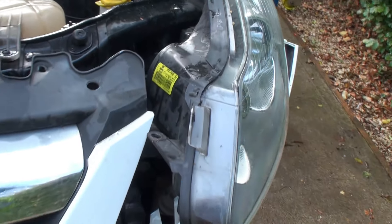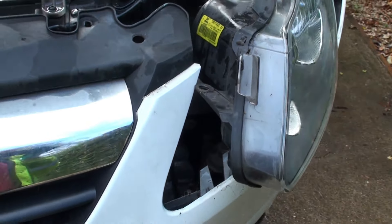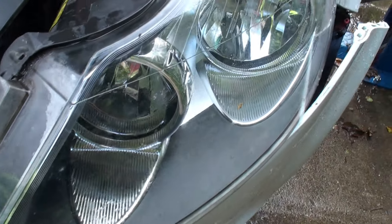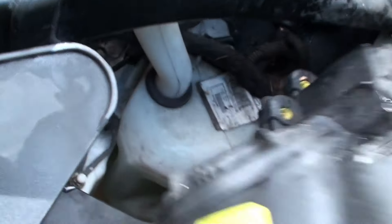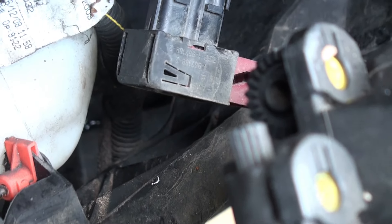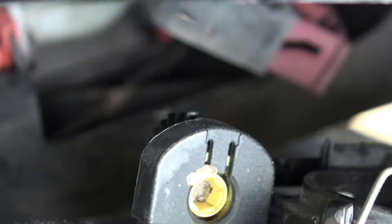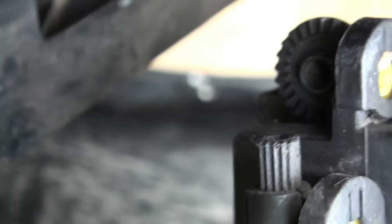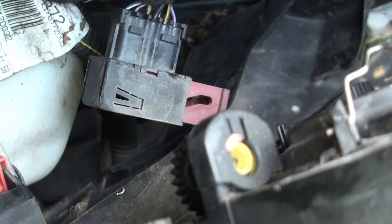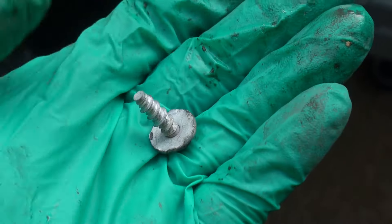This just shows how people that make these cars don't expect ordinary people to do anything as simple as change a bulb, because this is getting more and more complicated. You wrestle the headlight out carefully by pulling this away and get the headlamp in position. There's the socket - I pulled out that plug there, with the red lever. The connector plugs into a socket just at the bottom of the headlamp. To get it out you have to push that red thing through with a screwdriver.